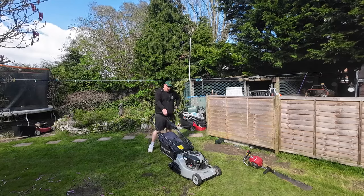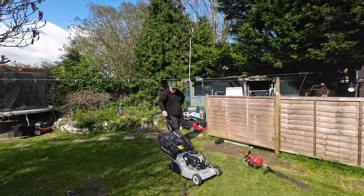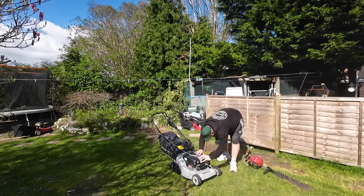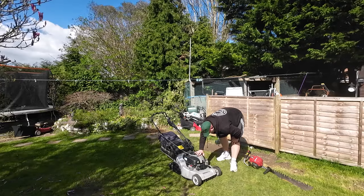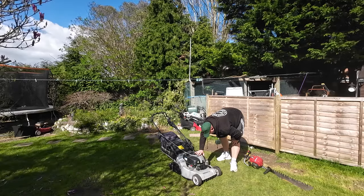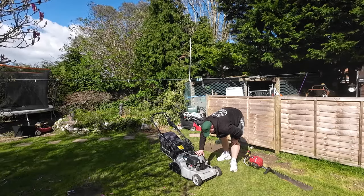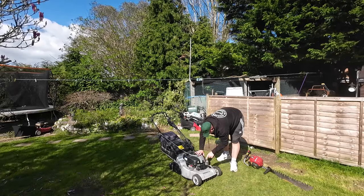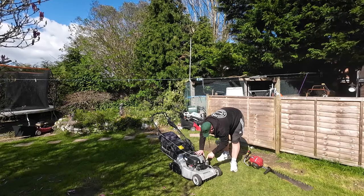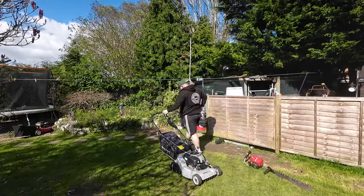It's got rod knock. When it gets hot, the engine slows right down. So I'm after another engine for this, a 750 EX. Get ready for these numbers, guys, because you can help me out. The numbers are 100602-0030H8, and then 14101088. I'll do it again, I might muck that up. Right, the number is 100602-0030H8, and then it's a 14101088.